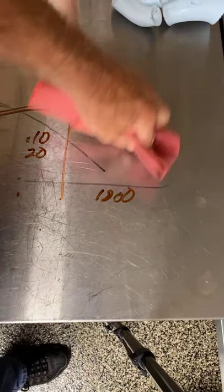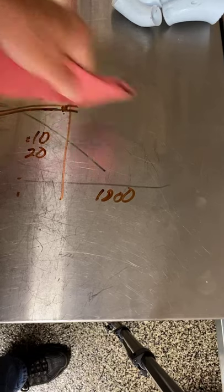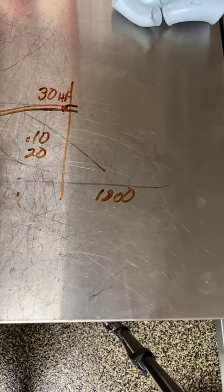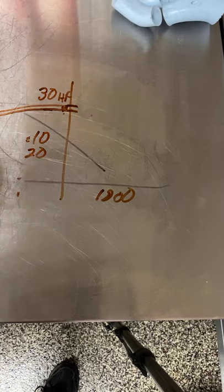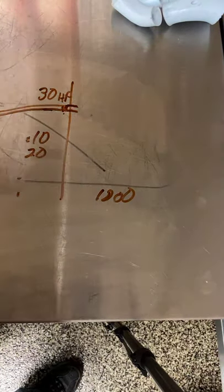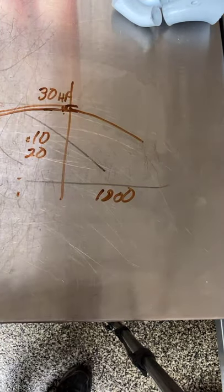Now, in my racing, we've always used a G-meter to set shift points by. If the dyno said that you only turn at 13,000 and we qualify number 16, and then if we turn it 14,000 and we qualify number 1, and then if you dyno it, of course nobody would dyno it there, it doesn't make any power. I mean, if you had an engine that peaked horsepower at 13,000 and you turn it 14,000, you're over here killing it.